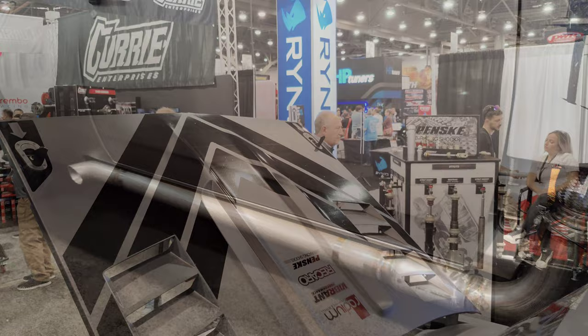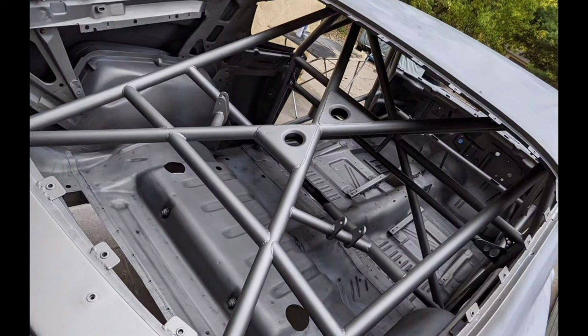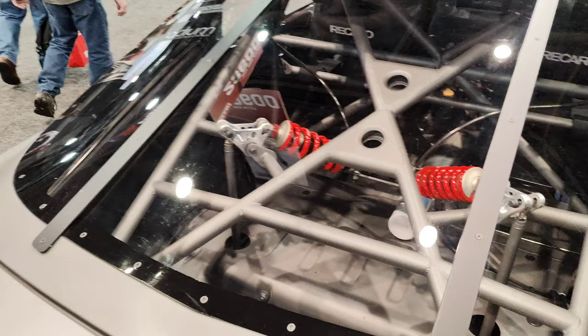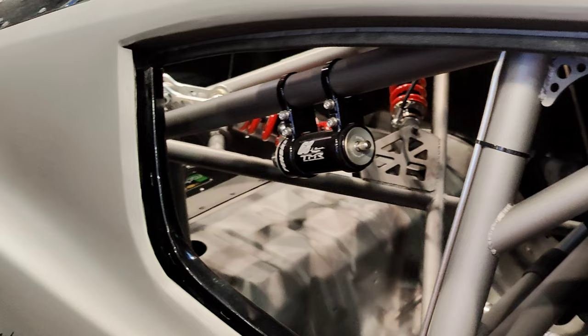There's a girdle in the oil sump so you don't get oil sloshing around. It's got Penske suspensions with the cartridges separated — that's why it's all routed through here, making it very responsive. We did remote canisters so I can easily access and change the pressures both front and rear. For the front, you just get your hand behind the tire and you can adjust. For the rear, you reach through the quarter window — my arm is long enough to access it.